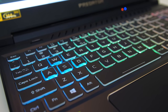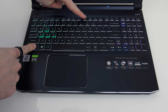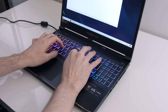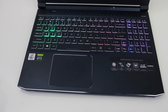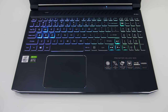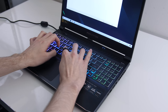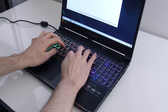The keyboard has 4 zones of RGB backlighting and all keys and secondary functions are illuminated. There are 4 levels of key brightness, or you can turn it off with the F9 and F10 keyboard shortcuts or through software. Let me be clear — the keyboard alone is enough of a reason for me to not want to consider this laptop, it was very annoying to use. Basically, some key presses don't trigger unless you push hard. When playing games I had to fully hold the keys down completely — the key press ends even if you just slightly reduce pressure on the key, even if it's still fully actuated. So when walking in a game, unless I go out of my way to hold the keys down extra hard, you just randomly stop moving. The keys themselves felt fine to press, and typing otherwise felt the same as the older version.